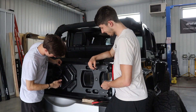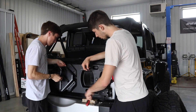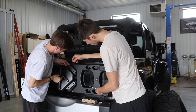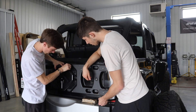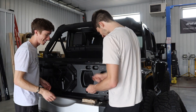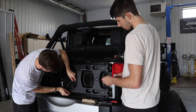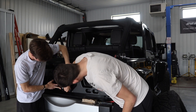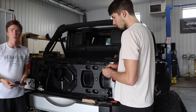For the next part of the installation, we're going to be installing the tire carrier. This is going to be an adjustable tire carrier, so if you are running bigger or smaller tire sizes you can move the tire carrier up and down depending on how big a tire you have. We're going to be reusing the factory bolts that were in place for the old tire carrier, and there are rubber gaskets that we're going to put in between the tire carrier and the tailgate as well as the hinge reinforcement — this will prevent scratching and hopefully minimize rattling.